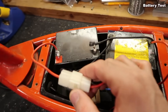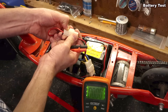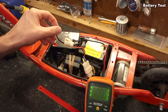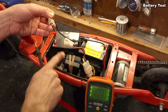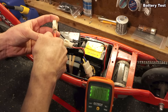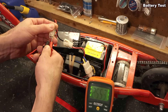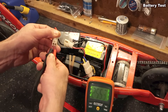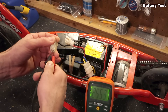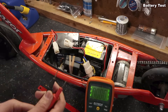What we'll do here is disconnect this battery. If you push down on the connector you can release it — and that goes for all of these connectors. I have the meter set to volts DC. Each battery is 12 volts, so let's see if we're getting at least 24 volts on the meter. I'm going to insert one lead on the left and one on the right. It doesn't matter which way — the only difference will be a negative mark on the display if you have them backwards. We have 25.5 volts, so these batteries are good.